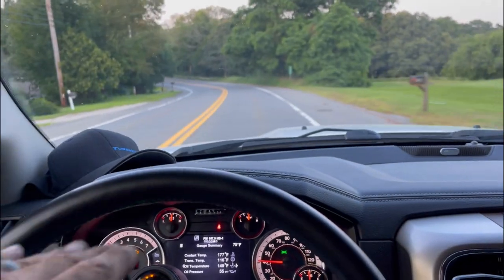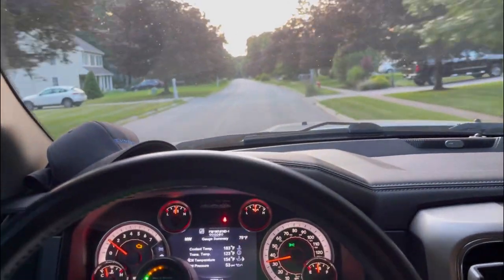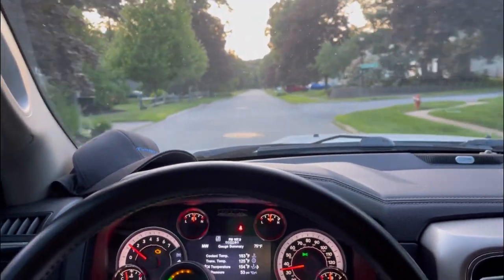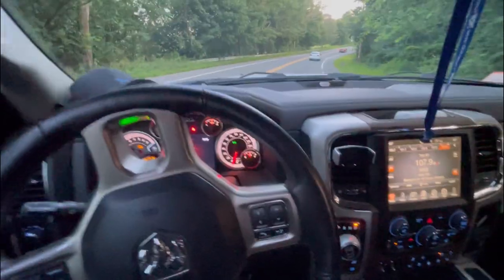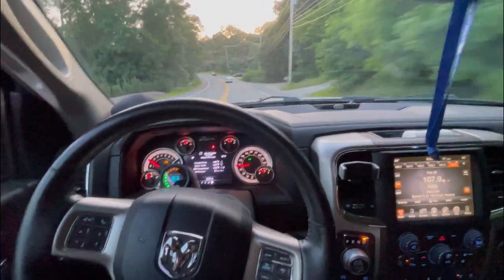I like the fact that the nose doesn't dip down when you nail the brakes. You do feel the bumps a little more - I'd say about 20-25% more - and that's expected. This kit uses the front springs which is nice, it just kind of squeezes them a little bit so that part still feels pretty stock. I'm going to let this settle for a week and then get an alignment. On a scale of one to ten for difficulty it's probably a six - I have just basic tools and no lift. I'll do a review in a few months and tell you how I really feel about it. Thanks for watching, until next time!